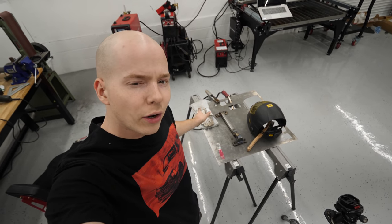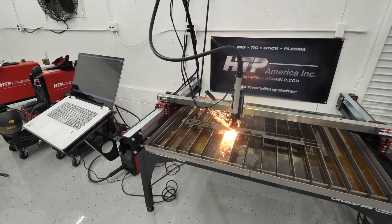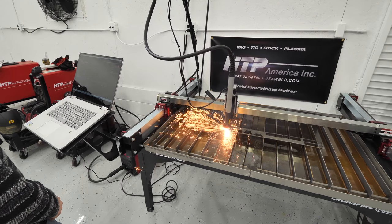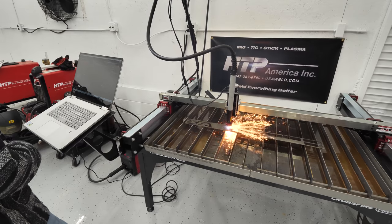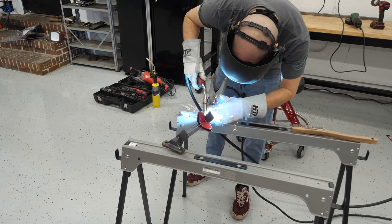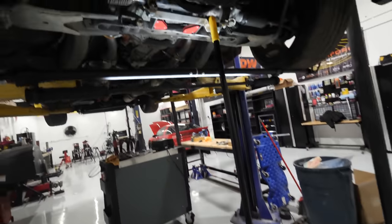So that's 100% done — that is the steering rack mount — but that's not the entire thing. Now we have to make something that connects this to the subframe of the drift truck. But I've been here working on this for 12 hours; it's been awesome, but I am tired. So I'm going to go home and we can continue this tomorrow. Looks like I got some weld spatter on my lens cover — good thing I was smart this time and actually got a cover. And there we are: the mount is held in place with a broom on a jack and some magnets.